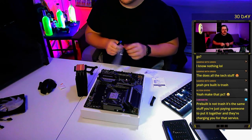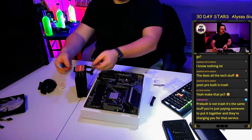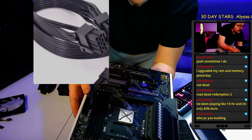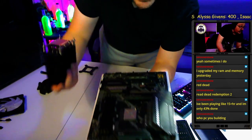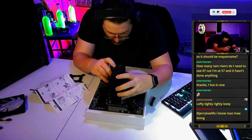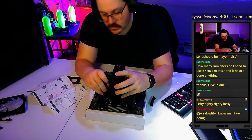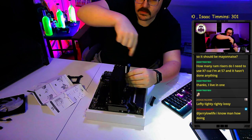The retention plate on this cooler comes with a couple of brackets that mount to it, and then we screw those brackets into the motherboard. You line up the holes on the cooler with the holes on the motherboard — there are four mounting points. Push the cooler down, get a couple of threads to grab on each screw, then tighten the rest of the way. We go around in a cross pattern to get even pressure — like changing a tire: top right, bottom left, bottom right, top left.